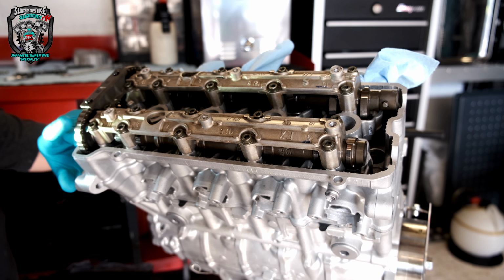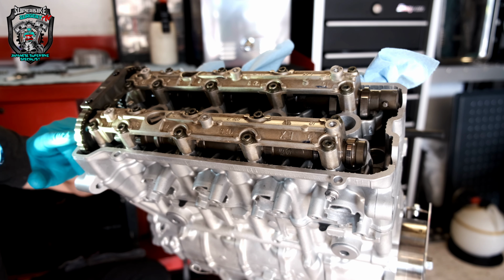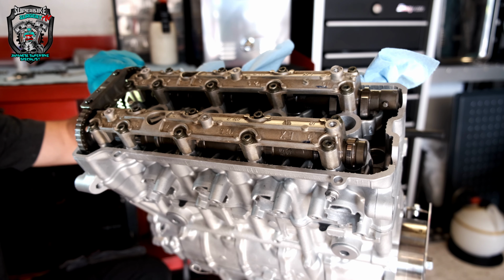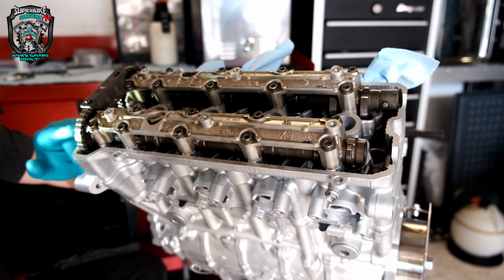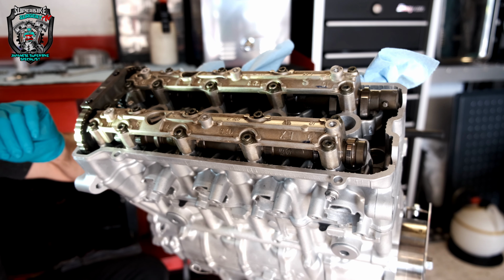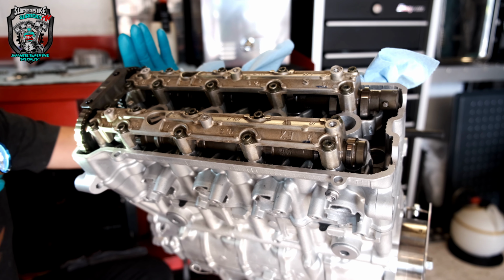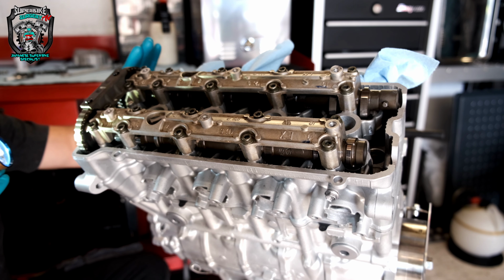So, Suzuki do, how to say, normally with most bikes you'll have a line for the exhaust cam and a line for the inlet cam. I'll flash a picture of the valve timing diagram on the screen, but with Suzukis, which I much prefer, you always put the exhaust cam in, depending on which side the cam chain tensioner is, because some engines rotate in a different direction, let's not go there.